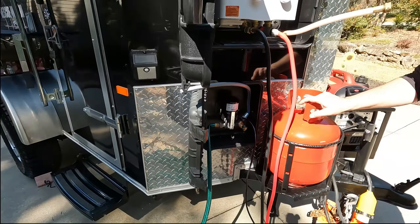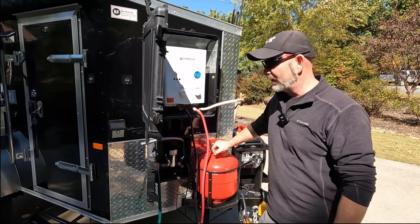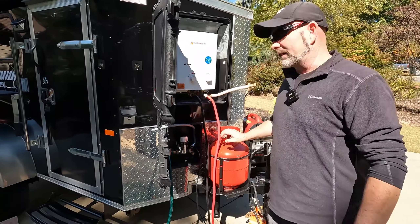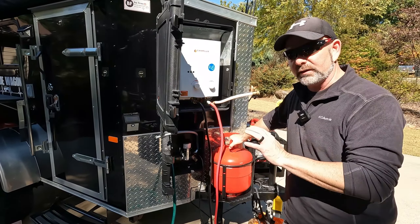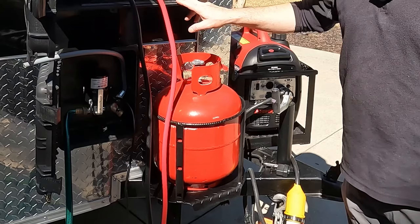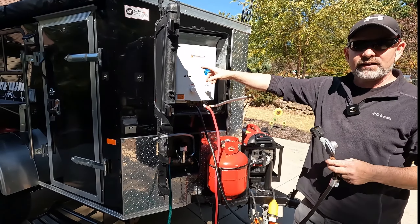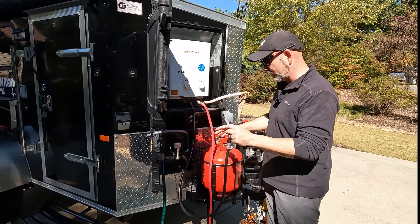Now you will notice some rust in there. That rust comes from being out at the Outer Banks wherever there's salty air. Even if you try to rinse it off, a lot of times it still does that. So next time I go out there I'm going to put a little grease over top of any exposed metal to try to keep it from rusting. And like always, anytime we're mounting anything to the side of the camper I always put butyl tape behind it — that way when you seal the butyl tape to the side, it doesn't leak. One of the first things we mounted right after we got the shower was this propane tank right here, because it takes a lot of gas to fill a hose and if your gas tank is somewhere else it wastes a lot of gas just to get the hose filled up, so we wanted something very close.